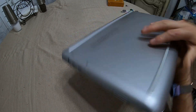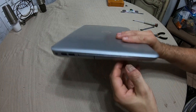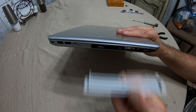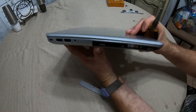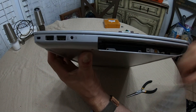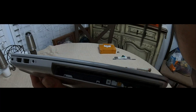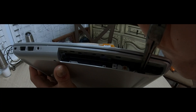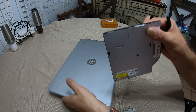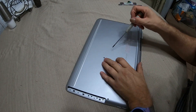Now I'm going to close the laptop and flip it over. On this side is the CD-ROM drive. I'm going to pull it out — mine's actually broken so yours will come out as one unit. I take a pair of long needle-nose pliers, there's a little metal tab, I pull it up like this and slide it back in, then basically pull the drive out. Set it aside.